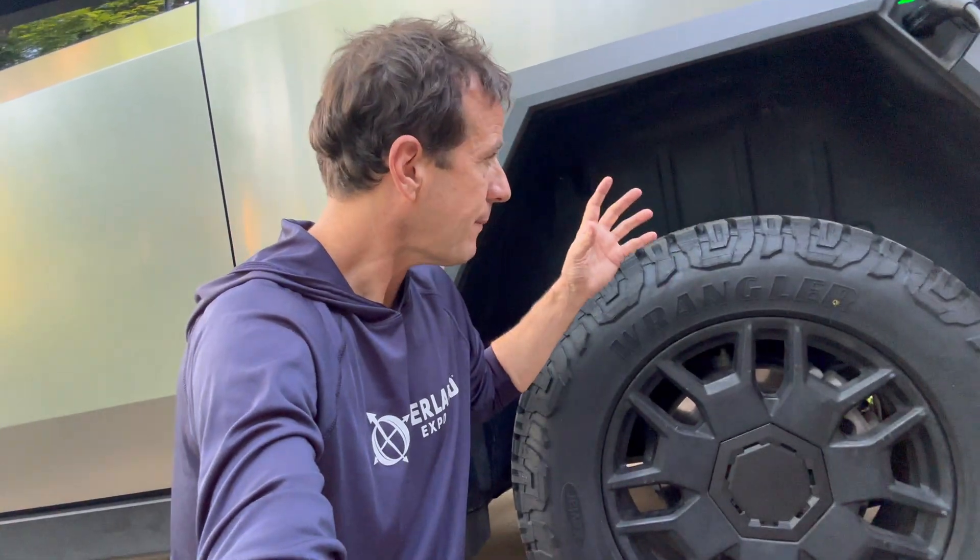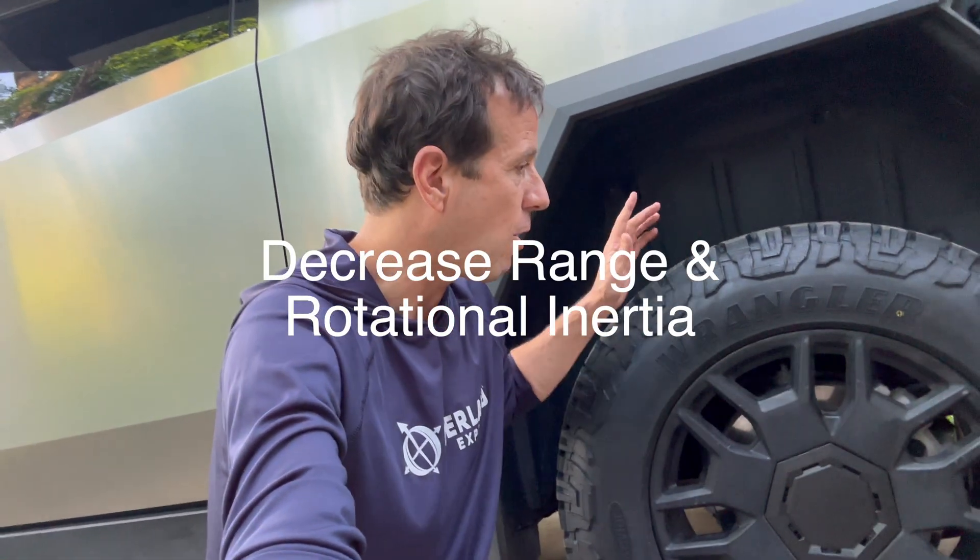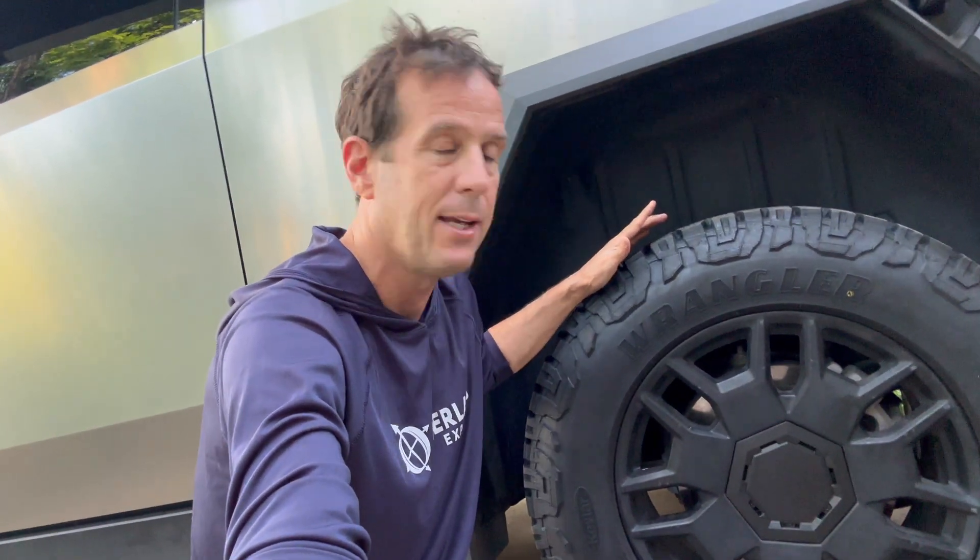Even if a bigger size fit, it's heavier, and with more rolling resistance, you lose whatever range benefit you had. For me, priority is range. Going with a bigger tire is going to increase range loss — they're suggesting about one to three percent. The Toyos, I think, were about one percent. But again, the Toyos in the right size don't exist.